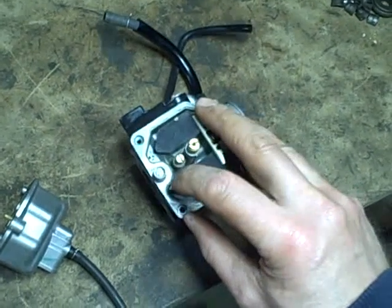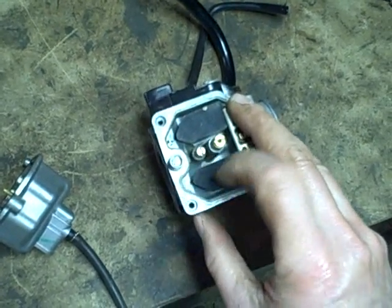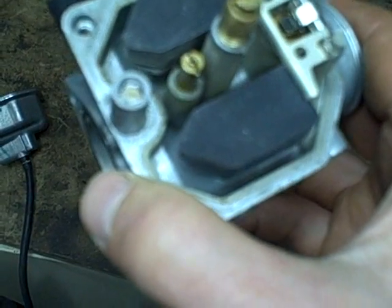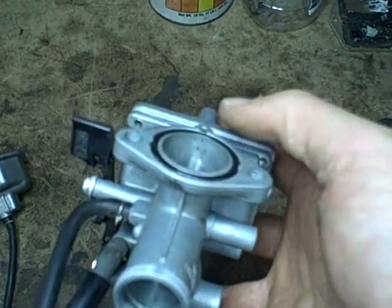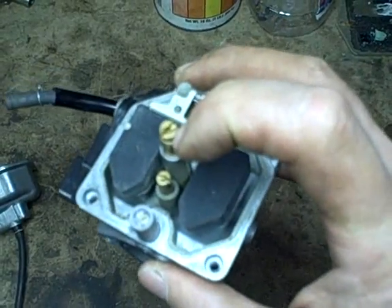It looks like there's a main jet here and another one here. This is usually where you would have your air-fuel mixture or pilot screw. Can't really tell what's in there — can't tell if that's a brass plug so you can't adjust it, or if somebody ground the head off the screw. Looking at it under magnification, that sure looks like it's a plug — in the category of 'do not attempt to adjust.' It looks like there may have been another plug covering that completely that somebody took out or it fell out. That corresponds with that tiny little hole right near the intake side.